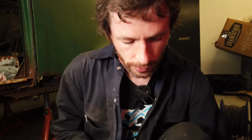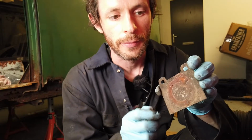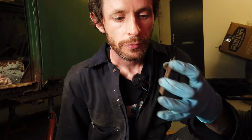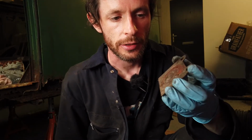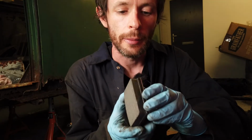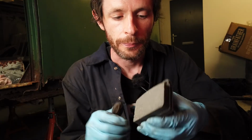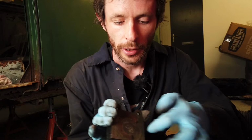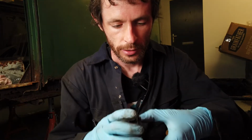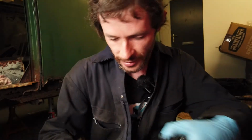But also, what we were missing as well on the red van was these backing plates. You can see where the piston impacts them here. So I have new ones of these as well. These are off the green van. But I'm going to put this plate in behind the new brake pad. Put a little bit of grease on both sides of it, it's like a little copper grease, and then slot it back in. But yeah, you can see where those little tabs kind of locate on the piston. So that's a selection of brake pads of varying quality.